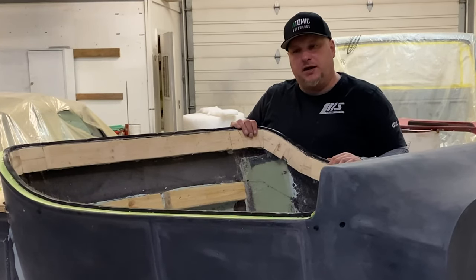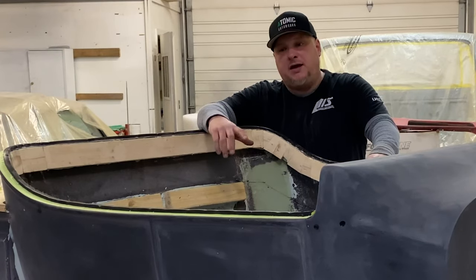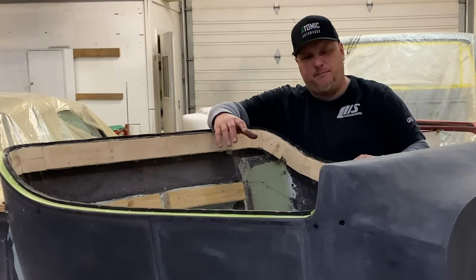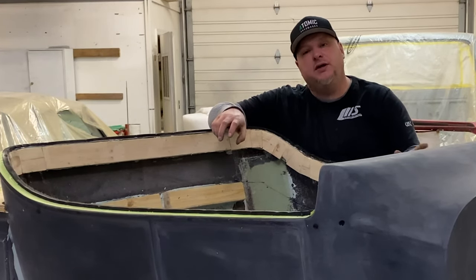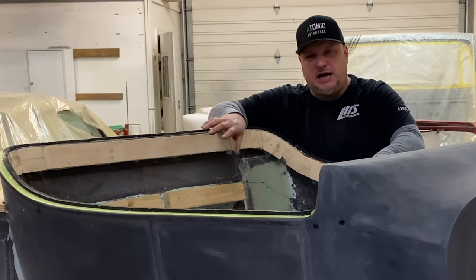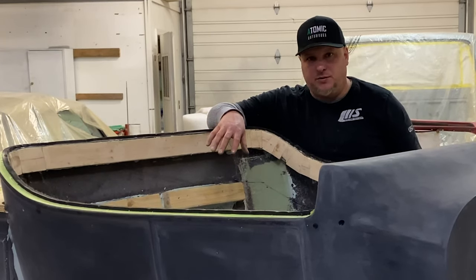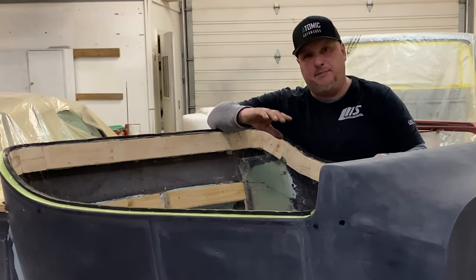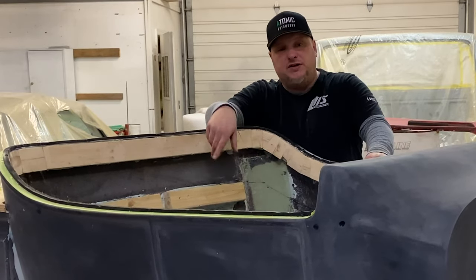Since I've done thousands of these I know we're not going to have an issue — plus I'm the one painting it, so if there is an issue I'm the guy that has to fix it. I still have to bond a little more wood in. The wood gives you an area to screw your interior panels into and it also stiffens up the body a lot. When you bond this wood on, the body filler is going to dry and shrink, and even when you're careful it's possible to get some warps or waves. So you want to have your entire interior wood structure bonded in and done before you go to the outside and do the body work. If you do it the opposite way — body work first, then bond the wood — there's a near-certain chance you'll end up with waves that wouldn't have been there.